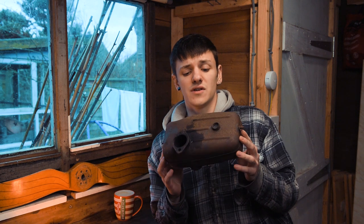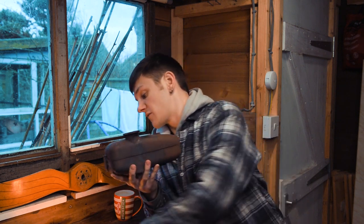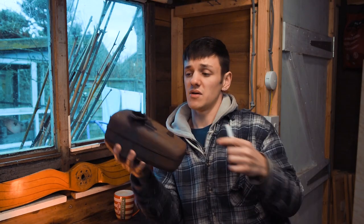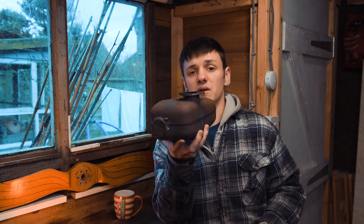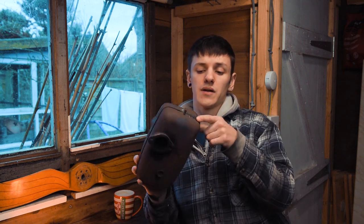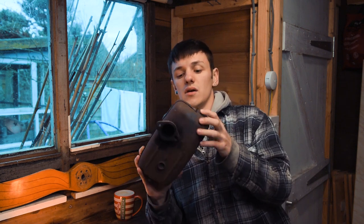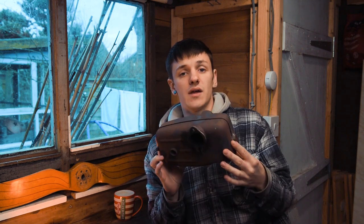This has been sat for years and years, it's gone rusty as hell, and we've got a few issues with it. Firstly, this exhaust flange isn't flush anymore. And this dent here is from an impact and it's bent that exhaust. So we're going to try and hammer that flat and then we're going to belt sand it. Also on the top here, it looks like there's been some exhaust putty put on. We're going to chip that away, clean that up and then reseal that. Give it a good wire brushing all the way over and then paint it.